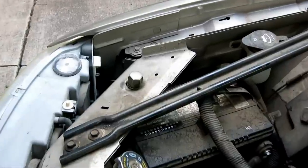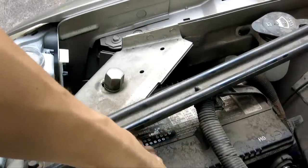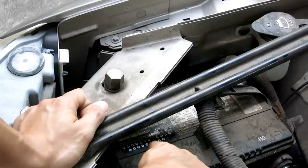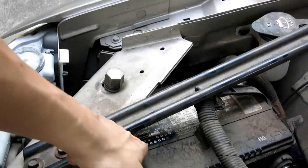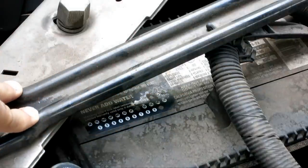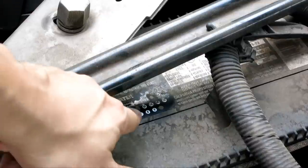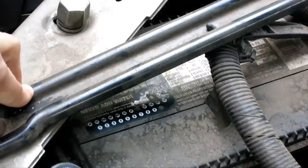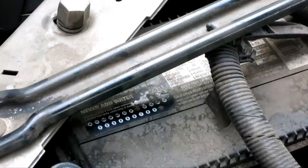So how do I know how old my battery is? If you look at the side of batteries there's always a date it was produced. Right here they use a punch hole system from one to nine and then zero. On the zero portion there's a hole punch, which means this battery was manufactured in 2010. On the top section it shows that the August hole punch means it was August 2010 when this battery was produced. Now it's 2014 approaching July, so it's about four years old and it's a good time to start replacing it.